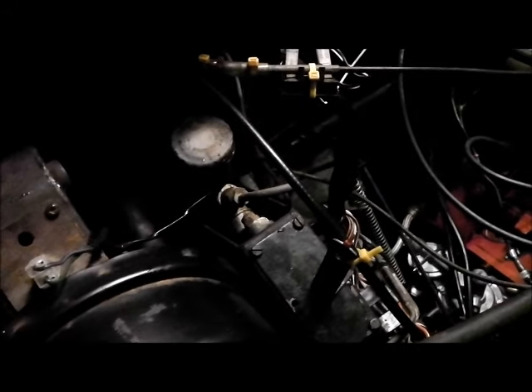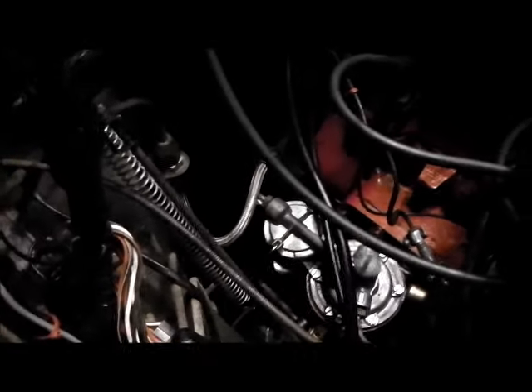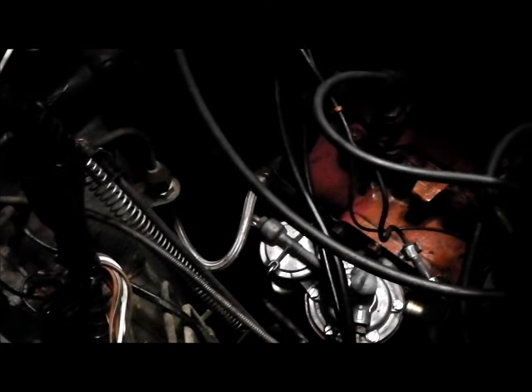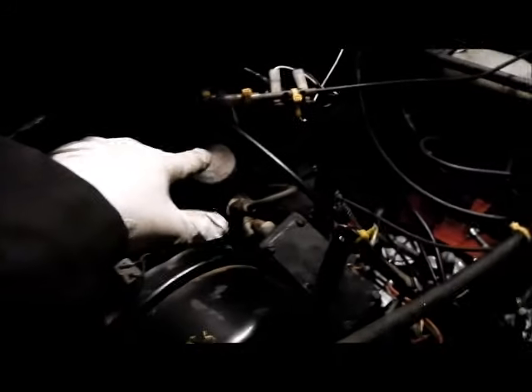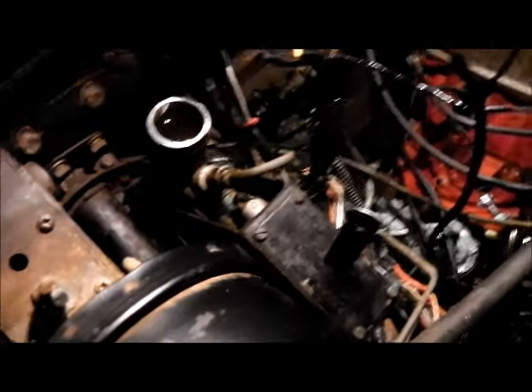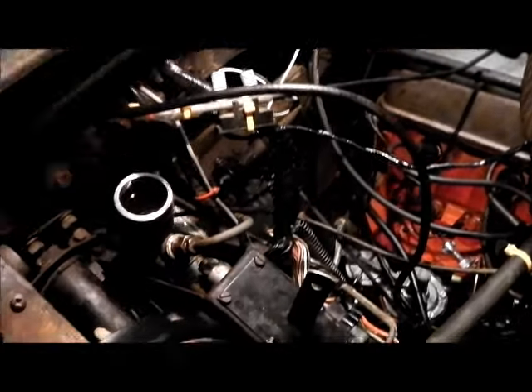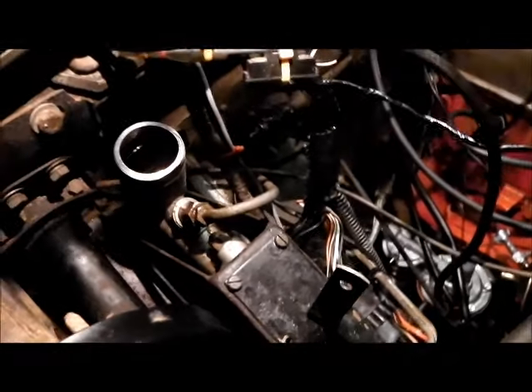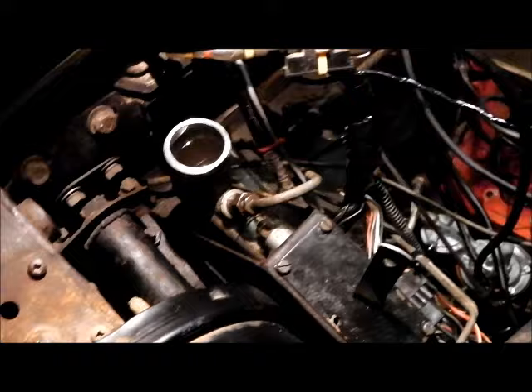It's generally a good idea to replace both cylinders if you're going to do one. A mistake I made a while back was replacing the hydraulic line - you can see the flexible hose - I put a stainless steel braided one on to try and make the pedal a bit firmer. There was plenty of flex in the old rubber hose, so that helped, but what I've done is the old fluid has been washed through from the master cylinder to the slave and the seals are starting to go. The master is also dripping on the left foot, so that's not so good.